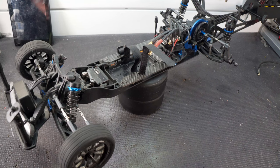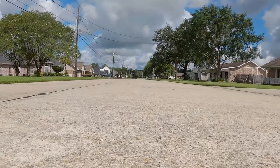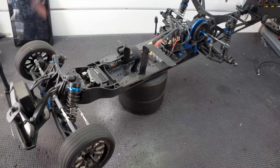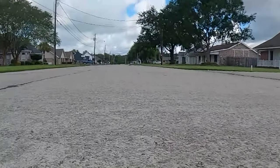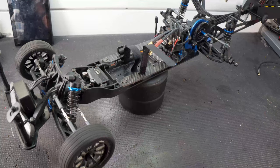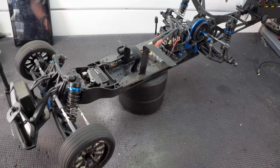Seeing that time got me a little greedy, so I bumped the throttle punch up even more to 50%. The next two passes went down and were relatively straight and smooth, but I believe the car spun a good bit - I think I even got one in slow motion with the GoPro. That's why the next two passes I ran a 2.25 and then a 2.30 and didn't repeat that 2.19. Once the car starts spinning, we're losing ET right then and there. But I got a little too greedy with it.